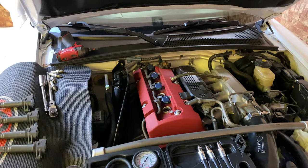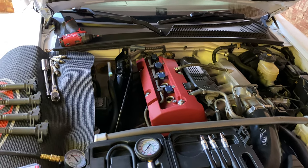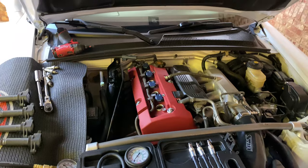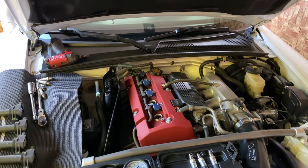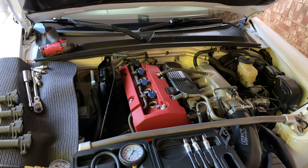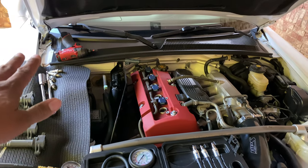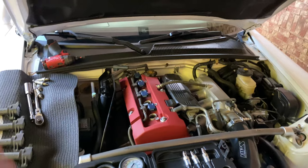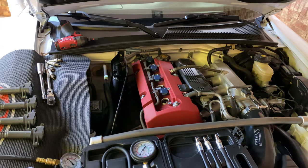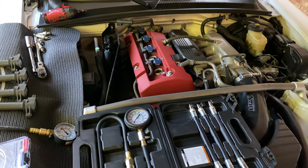So I did a second test, and it seemed like the gauge just died — I was getting readings of maybe 30 PSI. I checked the gauge, reseated it, checked the o-rings, made sure my battery was fully charged and I was getting a good crank. Tested it a third time and it did the same thing. Looking at online reviews, they weren't that great.